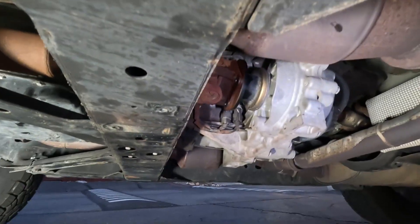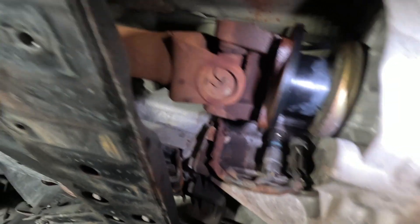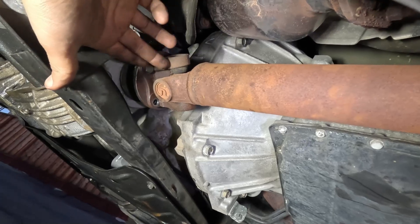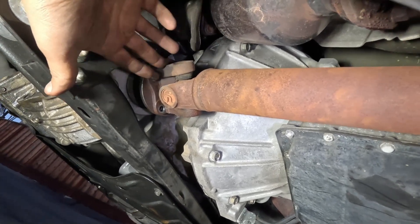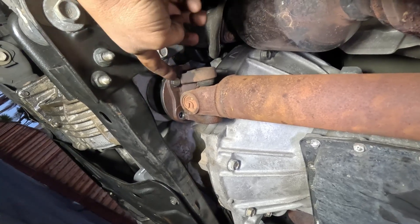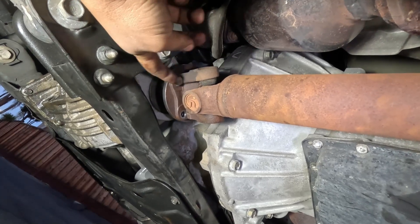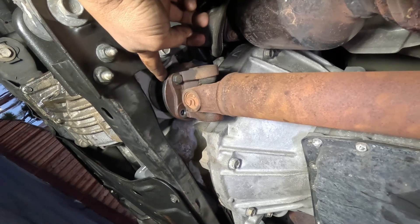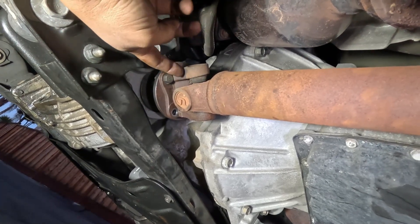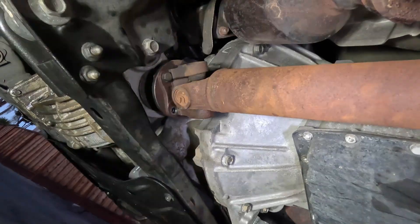It's been a few hours and I have all the nuts and bolts removed from the rear part of the driveshaft, but on the front I'm unable to remove two of them. Since the driveshaft is a little rusty, the surface that's supposed to keep this nut in place isn't what it used to be — the nut just keeps spinning. I don't have a good way of holding it still, so I'm going to end up cutting it on the driveshaft side — not the differential side — so that if I nick something, it's easily replaceable.